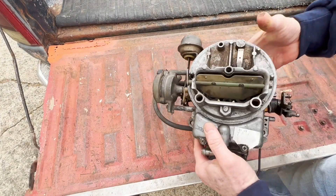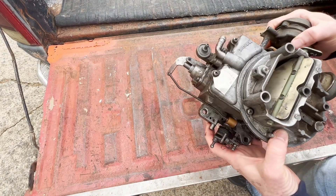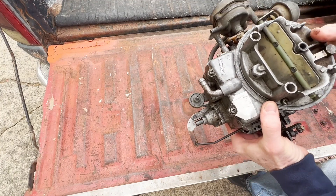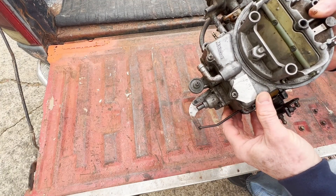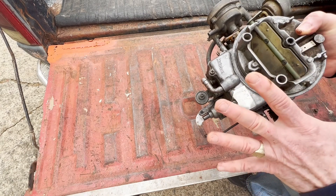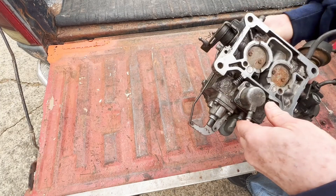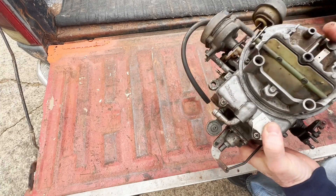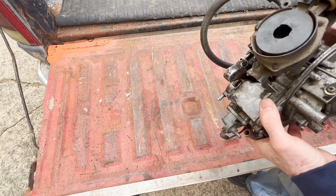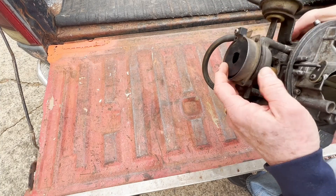This is the carburetor from this '83 F150. Motorcraft used this carburetor for about two years, so it is kind of rare and hard to find, but any two-barrel Motorcraft carburetor will work on there. I just wanted everything to match up with the linkages and such. I replaced it even though I had it working fine because the choke was long gone.